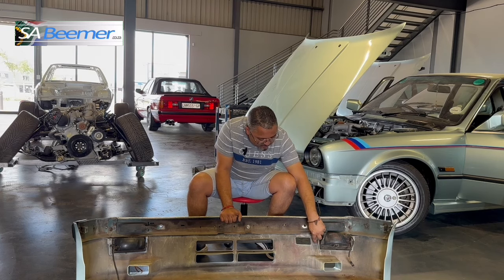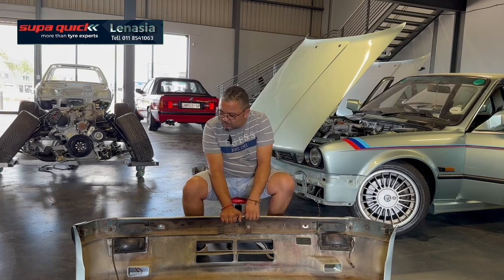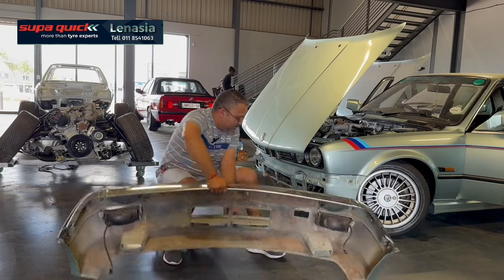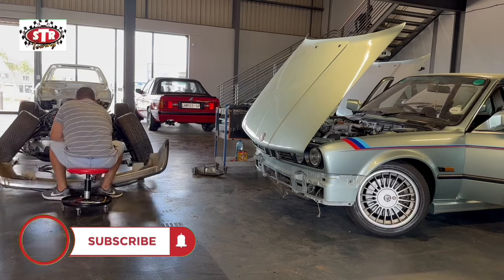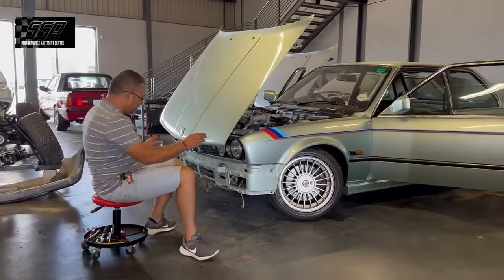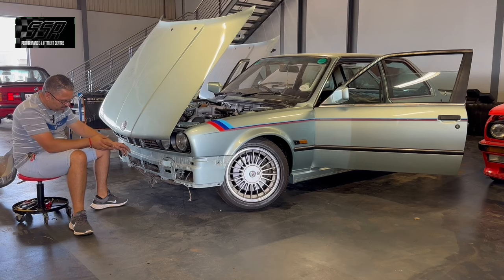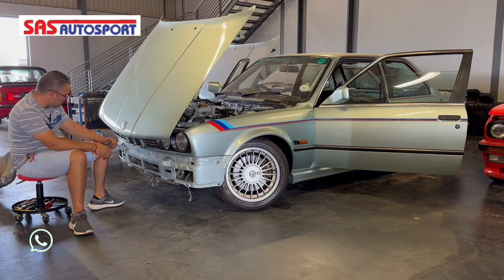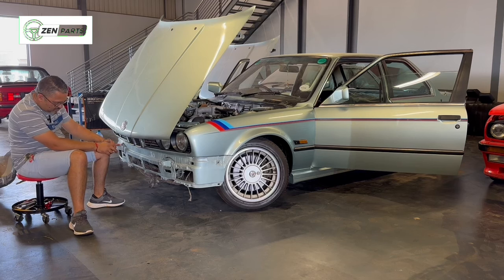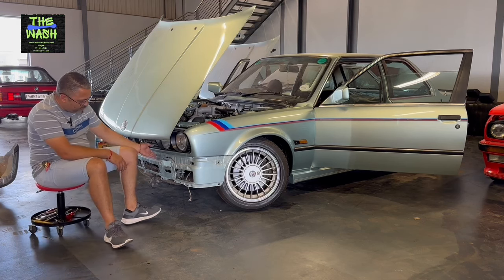Here are the clips on the spoiler and the apron, and this is the guide screw. The spoiler is actually not too bad. We're going to strip them later and get to the chroming side and look for the best bumpers. As you remember from the shadow line, it also had its valence on with different cooling grills. This valence is not supposed to be on this car. We're going to pull the valence off, and when we assemble, the valence doesn't have to get put back on. You can see this car was painted before - the wiring is a mess, but we know that from our checklist.